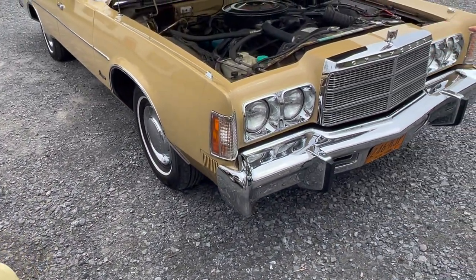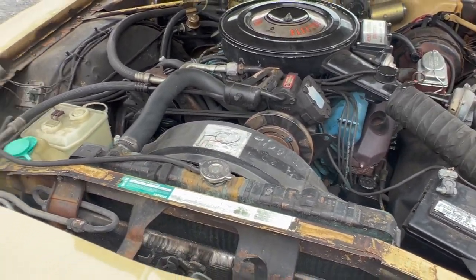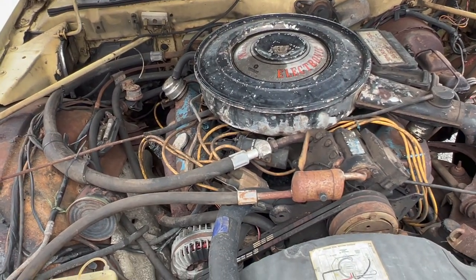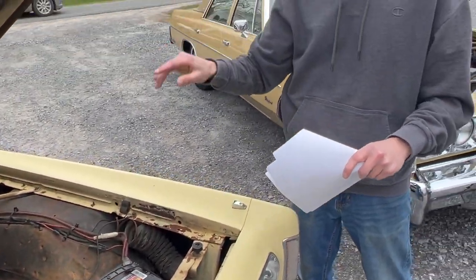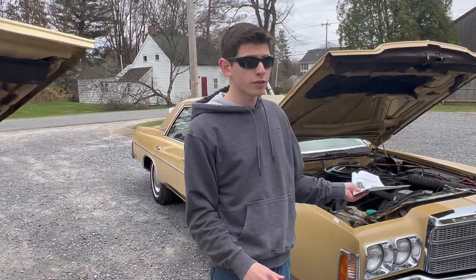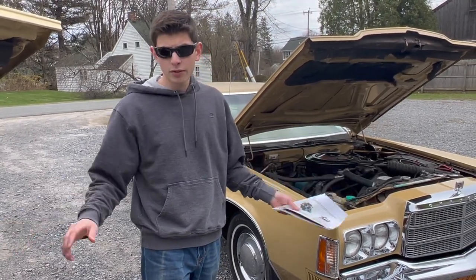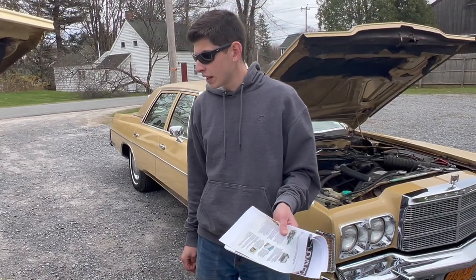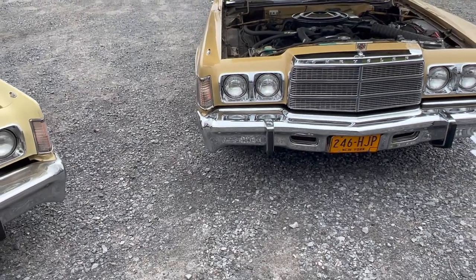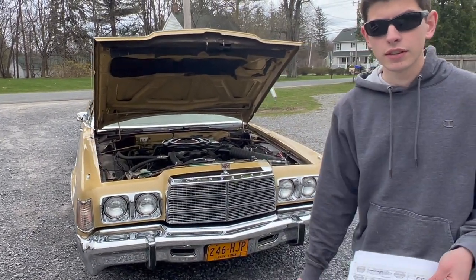It's all original — you've got the little air duct here. The Newport has just seen a lot more wear and tear, and it hasn't been in a clean environment. But to be fair, the 440 and the 400 — we haven't tuned up either of them. As they sit now, the 440 runs way better than the 400; this one's way more responsive, the 400 is a complete dog. I definitely would want the 440 for towing. Also, the fuel tank capacities are different — the wagon has a 24-gallon tank, whereas the Newport and New Yorker had a 26.5-gallon tank.